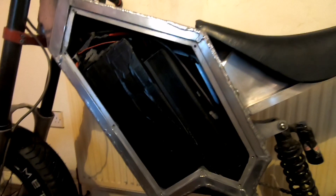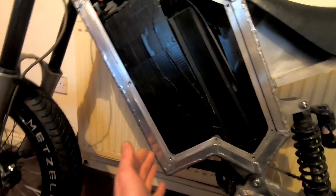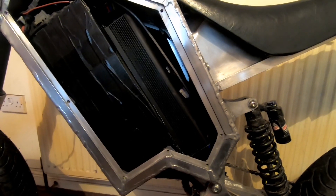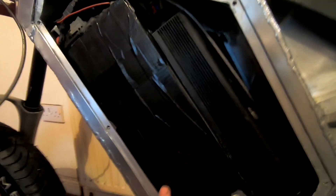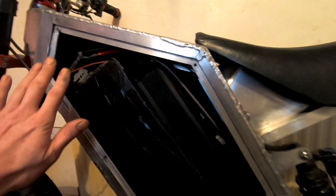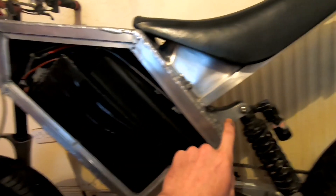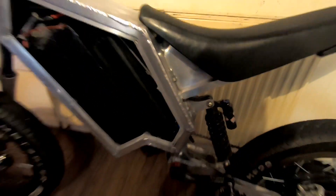You can see the battery is built inside the bike and the controller is in here. The reason — if you've seen the red bike build — I put the controller on the outside because it's got vents where airflow is meant to go through, as it can get warm. On the last bike I had it underneath, but this time I've put the same controller back on the bike — same electronics as the last build. I re-jigged the battery to make it fit inside this frame, put the controller on the inside, got everything insulated. My idea for cooling is to put a scoop on the side panel so airflow can scoop over and maybe put some vents on the back for airflow escape.